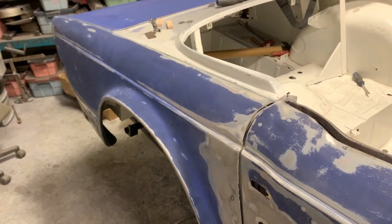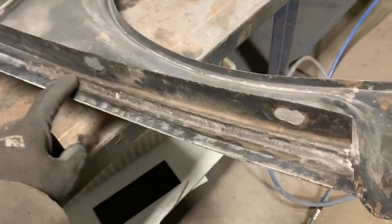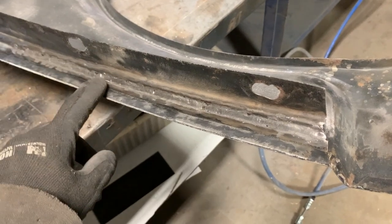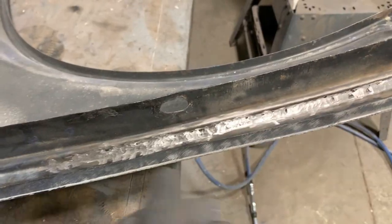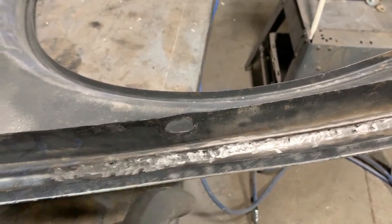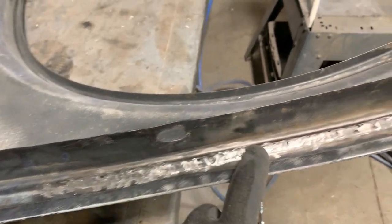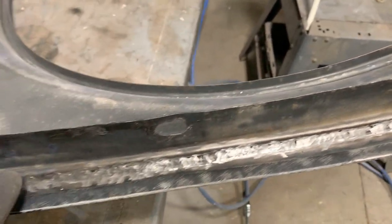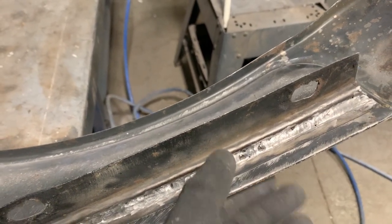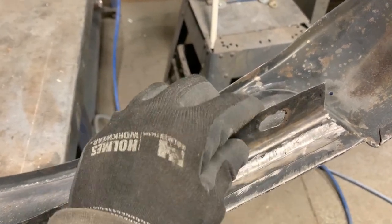We have the fender off, and this is the mount I want to modify. What I see is it's already been modified — and that looks like my handwriting, but honestly I don't remember doing that. It's fresh so it's obviously me. Anyways, whatever I've done I didn't do enough, so we're gonna have to cut again from the same area. What I think I'm gonna do now is cut it exactly on the corner all the way down, and open it like a quarter inch here. We don't want to open it too much because that's going to move the fender too far forward. In the worst case scenario, if it's too far forward, we can always put spacers between the mount and the B-post.